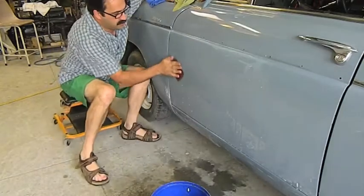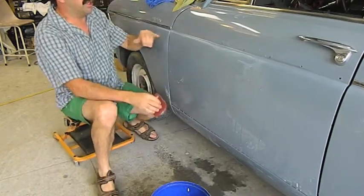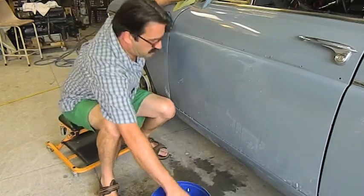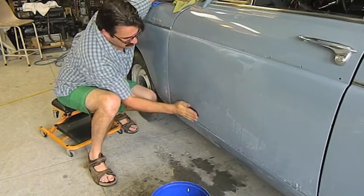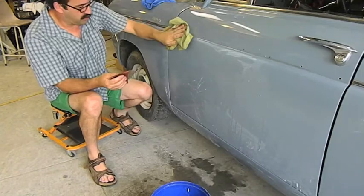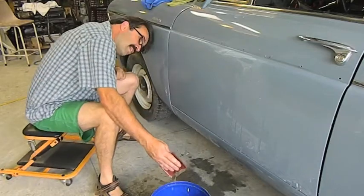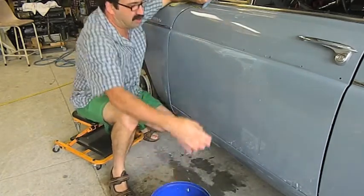I'm going over the whole door with some 1500, wiping off as I go just to see where I'm at. I have a criticism of my own work — I didn't run the clear high enough. I should have run it straight hard against the swage line, not blended at the top. When it's colour sanded you can see where it's blended, but that should buff out. I ended up painting virtually half the car — the lower half of the whole car — which I didn't really want to do, but in order for the rust to be fixed and for it to blend properly I had to. This is just going to be a clean daily driver, not a concourse car. But for it to look as good as I wanted, I had to paint pretty much the whole car up to the bead.